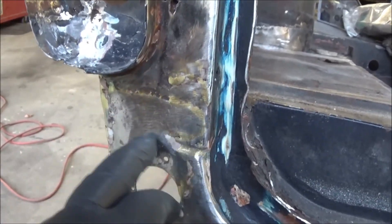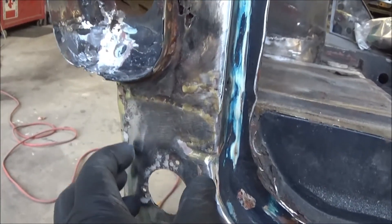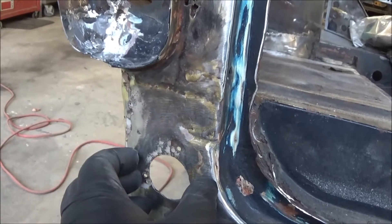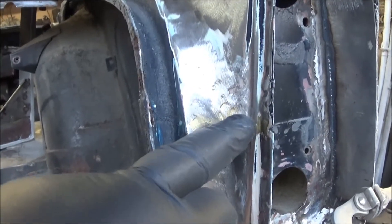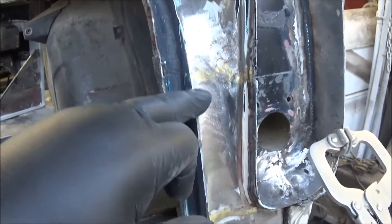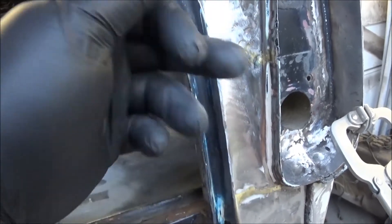From the photos I've seen, there's the reversing light, and the cut line seems to be just above where the actual round rubber bezel goes through the reverse light, so we'll have a look at more pictures of that. On this side, again you can sort of see where it's been cut around the middle where the brazing is. It looks too high to me — I think it's supposed to be down lower, but again we'll check some photos. What I'm going to have to do probably is make a cut in here, maybe a wide cut, and do an inverse sort of flange and bend it in.